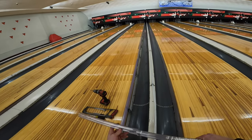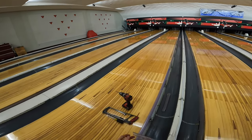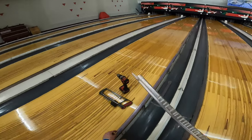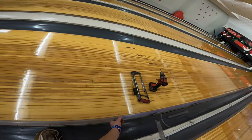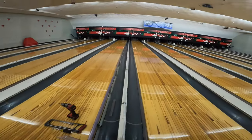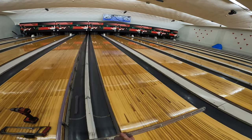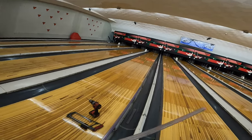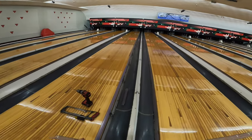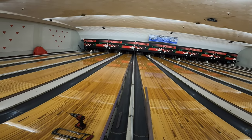One quick side note: even though this part of the bumper did break, I can still save this piece. If you take your saw and cut it off — you don't want to go too close to the bracket because it might bind up on the metal — make a cut just a little past this hole. Then you still have a good piece and can make little repairs all over the place. I have a lot of them up near the fronts because that's where they get damaged the most. Even though sometimes you have to buy new ones, you can still save a lot of the old pieces to fix small sections that are broken.